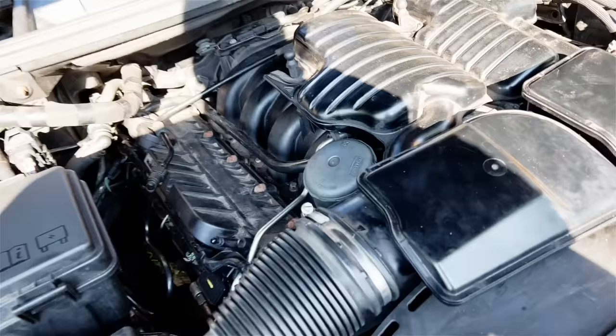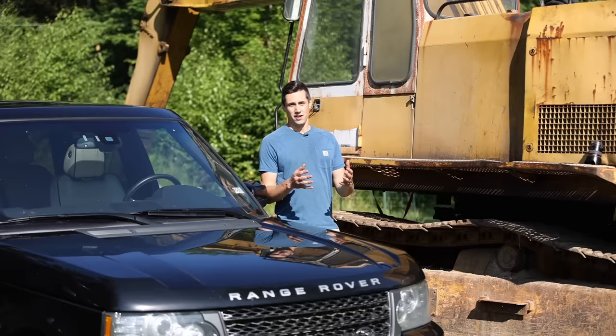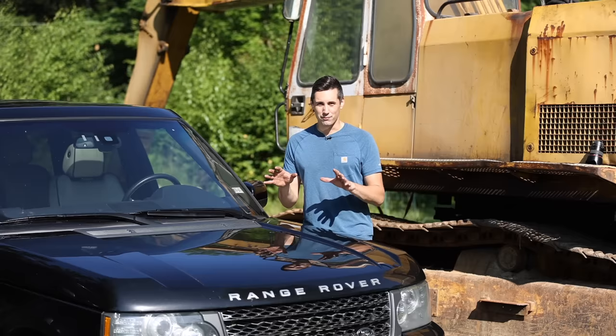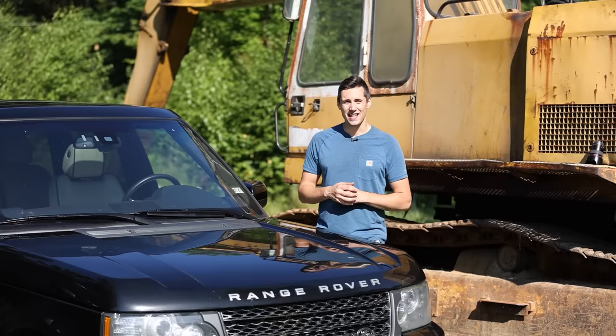Scenario two is that there is something seriously wrong with the engine that is currently generating or wearing all of that aluminum — if that's the case, it's going to keep happening until I fix whatever's wrong. I put another 10 to 20 miles on this thing and took a quick look at the oil filter — yeah, that's really, really dirty, it's full of aluminum again. So there's obviously something wearing inside this engine causing all of that aluminum in the oil, and it's kind of funny that it runs so well, because I'm pretty sure if I keep driving it like this it won't run well for much longer.